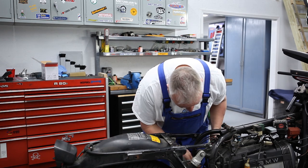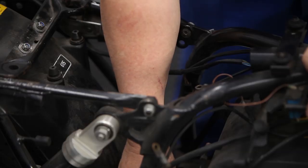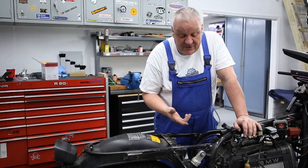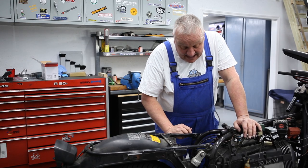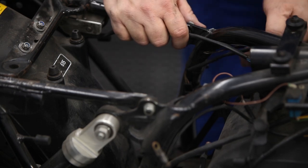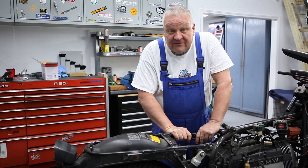The battery tray on the mono lever models is designed in such a way that you can use the big battery or the smaller battery. When you use the smaller battery you use rubber straps, which we also carry. I kind of like the big battery — this big gel battery — so that's what we're gonna run and show you how it is installed properly, in case you're working on one where all the original mounting hardware is gone.